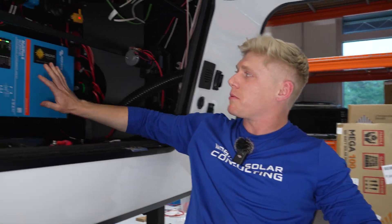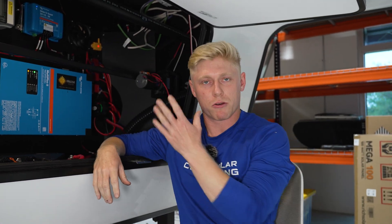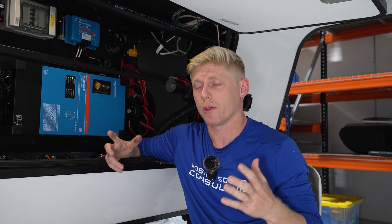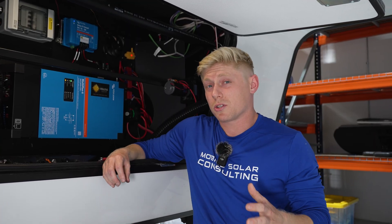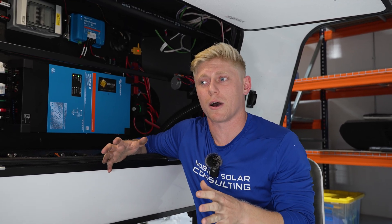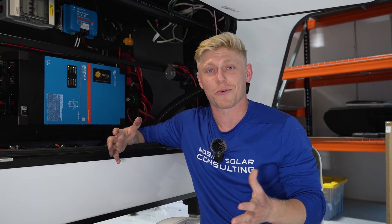In the front bay here we've got our Multi Plus 2 inverter charger — this is powering just about everything in the RV. Normally we tell clients it powers one large appliance or one air conditioner, but in this case we did put a Chill Cube up at the front. It was wired for an air conditioner but didn't have one, so we removed the Max Air fan and put an AC unit in. The Chill Cube is so efficient that for the most part this can actually power the Chill Cube and the Coleman AC in the rear at the same time. There will be times where it's too hot and the inverter would overload, but generally speaking they can power both ACs at once, which is pretty cool.